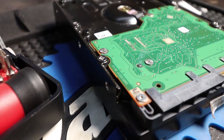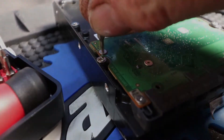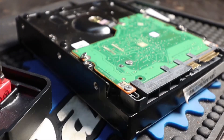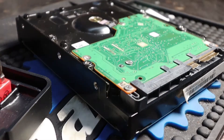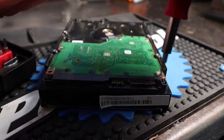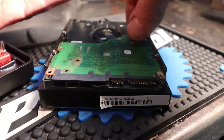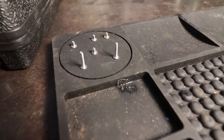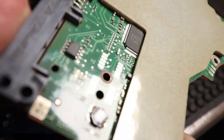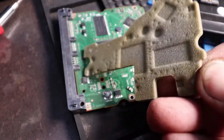After verifying the basic idiosyncrasies of the two boards, we'll take the T6 driver and remove the six screws holding the board onto the drive, paying close attention that the two screws closest to the plug connections are considerably longer than the others. In all jobs like this — take it from the master of losing hardware — it pays to lay the hardware out in a place where it won't get lost, in the order that it was removed. The board just lifts off the drive along with a thin foam cushion in which you can see the imprints of the chips. We're gonna reuse this piece.